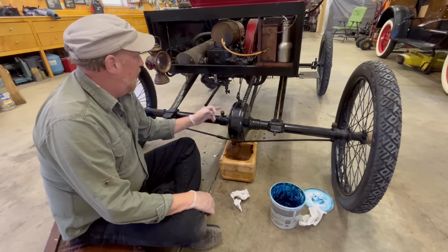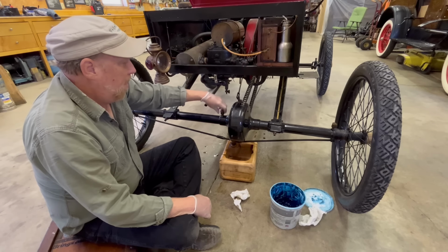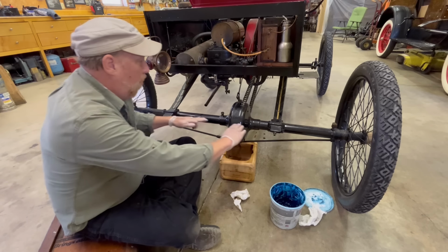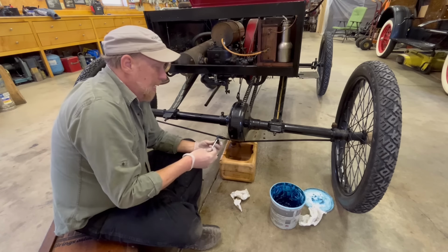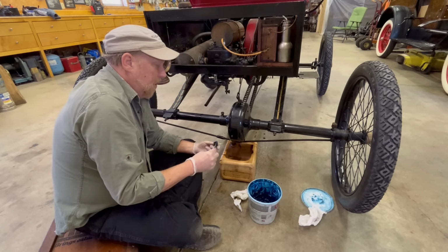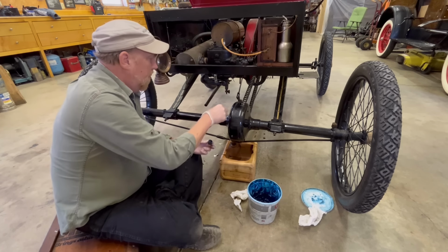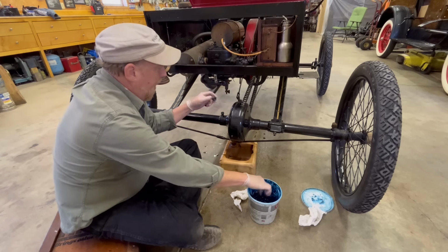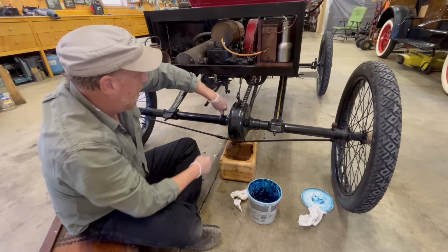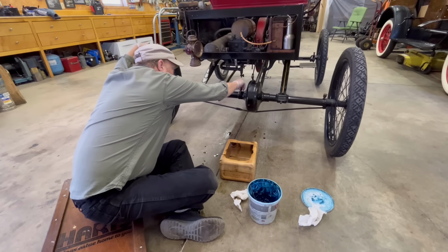I don't know if I ever showed you guys about grease cups and how you do them. I guess you assume you know it. I don't think I've ever shown this on my channel, but these grease cups are the way that you grease the rear axle. They don't run in oil. There's no oil running down through here continuously like the new cars do. So what you do is you get you some grease. I like using high temp blue grease just because I use it for everything. Anyhow, you fill this little cup up, and if this hole's empty, you put some down in there too. And then all you do is put the little cap back on there and screw it down. So when you're doing this, this is forcing the grease down into this bearing. And when I do this, I usually like to move the car so that it's not all going in one place.